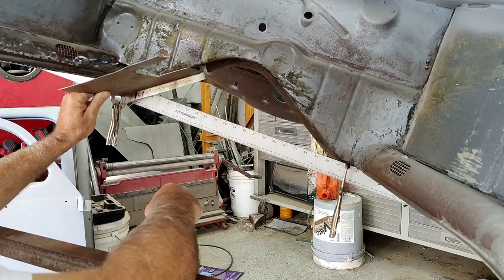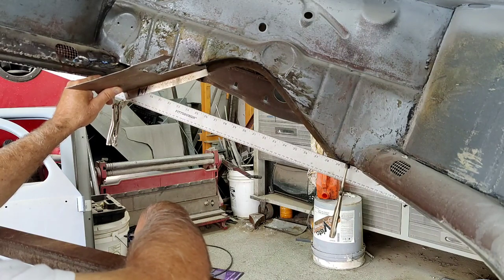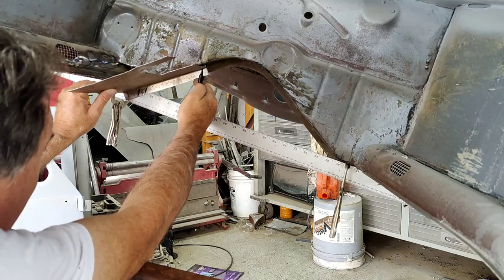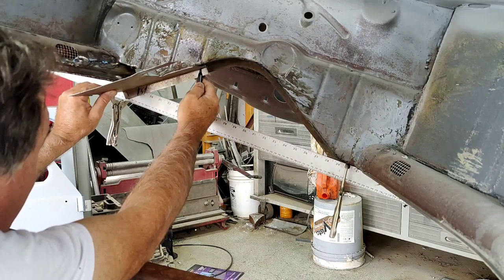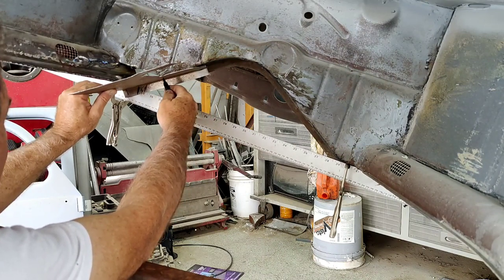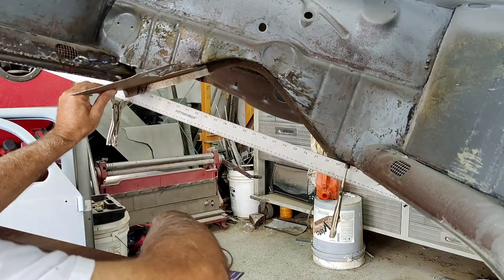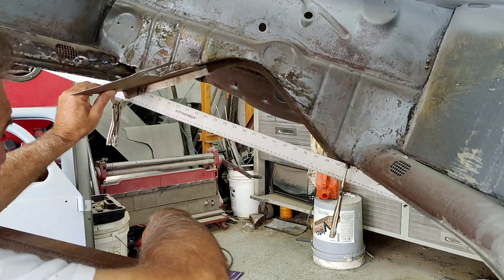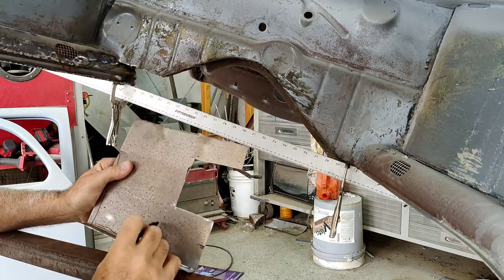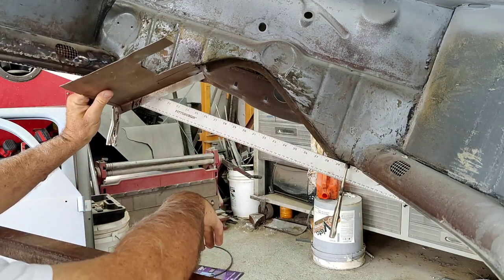And then we'll bend. We're gonna use the stretcher shrinker. But I think what I'm gonna do is first trim off some more of what I don't need, because I don't wanna bend this whole piece and waste it all. So I know that I'm gonna go along right here to about right here. What I'm doing is I'm looking on top and the bottom, kind of measuring it out. So I can cut just like across here. I'll just go up a little bit above it for now. I'm gonna cross there.